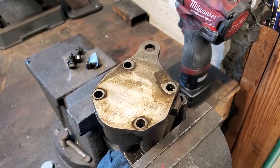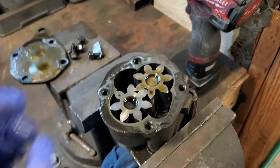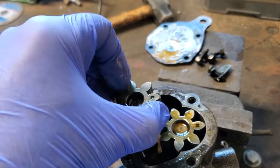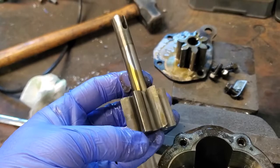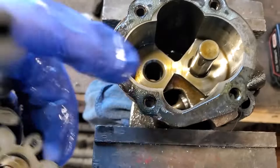In the spirit of procrastination let's take the old oil pump apart. There's the top plate and here's the two rotors — they seem to be rotating fine. Looks like it's still got a good meshing pattern. This is the one that slots in with the bottom of the distributor rotor. There's the rotor and the shaft. Like I said they don't look bad. Hard to know if this is a high volume or not, or if I was really having any problems.